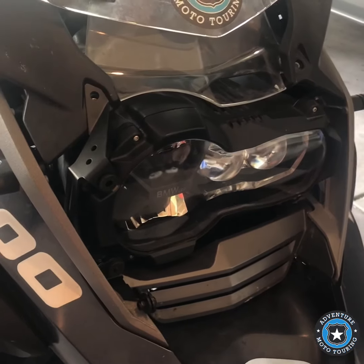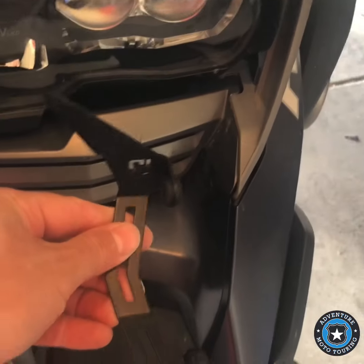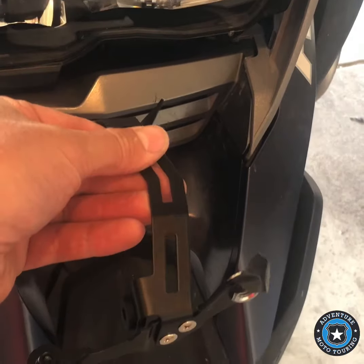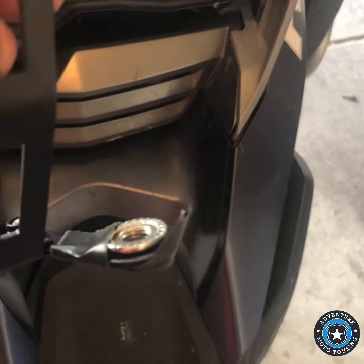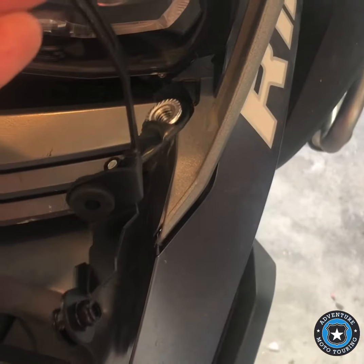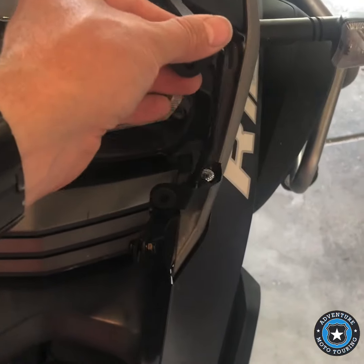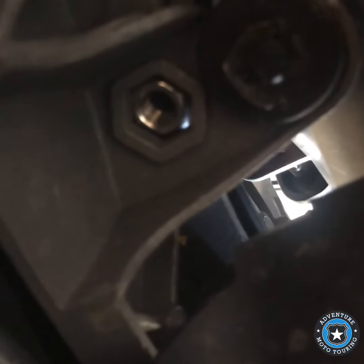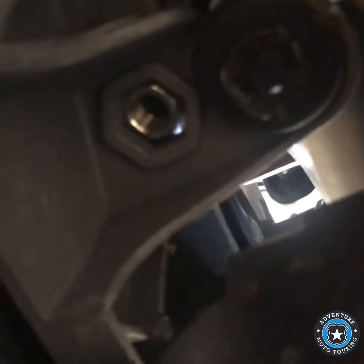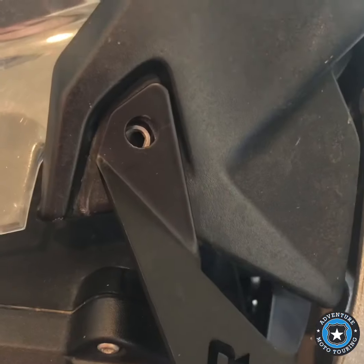The install for this Lone Rider headlight is pretty straightforward. You can see I've already got a bracket on that side of the light, and the bracket looks like this. A little tip — you can put a little piece of tape to hold a bolt that's going to get screwed in through the bottom of the bike underneath the fender. Then just work that through for the other side of the bracket. You can see that underneath the bike, that bolt just goes right through that hole and lines up. Then you attach the top piece on both sides like that.